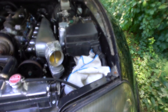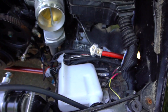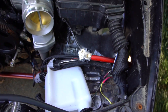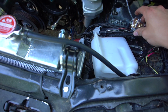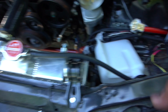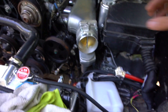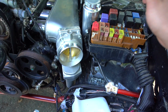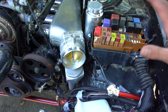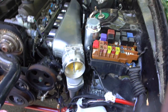The car is all wired. Going over the wiring real quick — starting from in here. Here's my positive cable, I've got a distribution block, I've got power in the fuse box. I did have another wire going on the starter but I took that out — I'll tell you guys why in a minute. The fuse box is bolted down now, but I went through the whole fuse box, connected some wires, made sure everything was good. There were some wires that were messed up, some wires had been cut. Figured that all out, checked all the fuses.